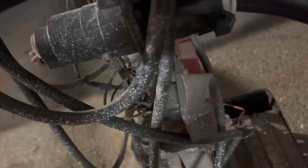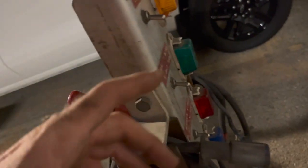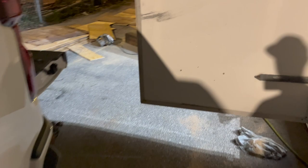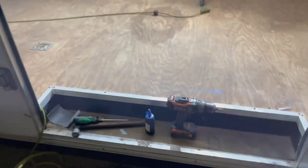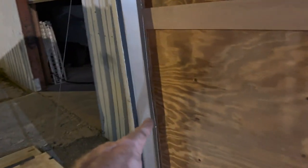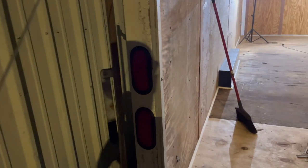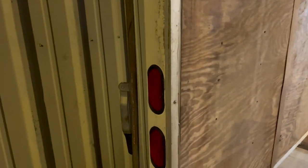I figured I'd try to fix the lights. I cut the old plug off and put a new plug on, but it was still back-feeding — when you turn any light on, all the lights would light up, which means there's a short. I found a junction box underneath and kept unhooking wires until the short went away. It turned out to be the running lights. Now I'm going to search for the problem — I'll take off this shield and access the wiring, because when I turn the blinkers on this side doesn't work.